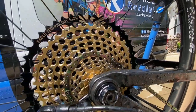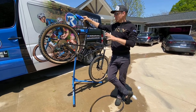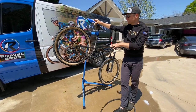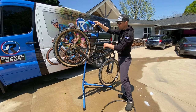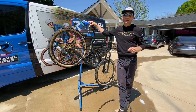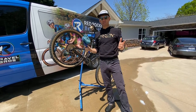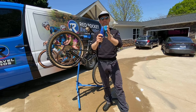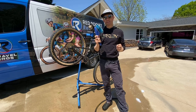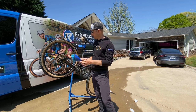That's about as clean as you're going to get — there's nothing on there. Step number five is where most of the cosmetic cleaning comes in. We've cleaned the drivetrain and stripped everything off. If you don't really care about the residue on the frame, this is a fine place to stop since it won't affect performance. But if you want a beautiful-looking bike, now we're going to do that. Use your separate frame brush — something with longer, less stiff bristles — and remember, don't use the same brush as your drivetrain.